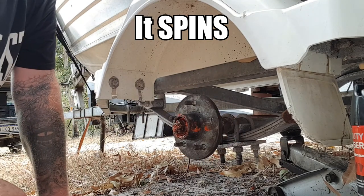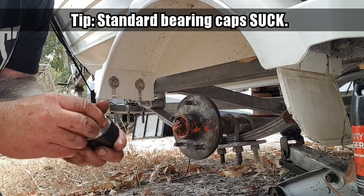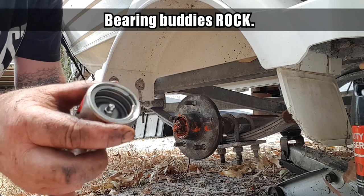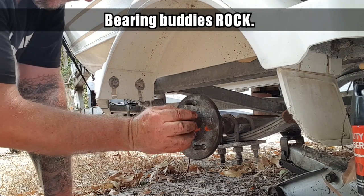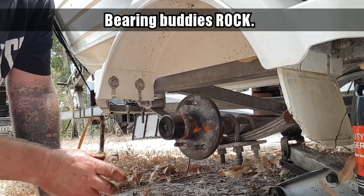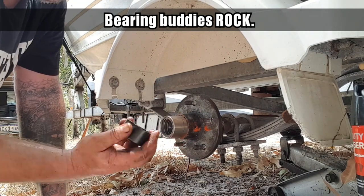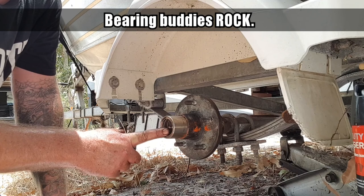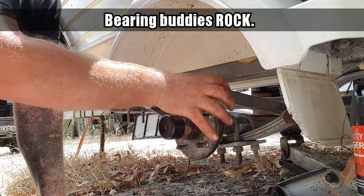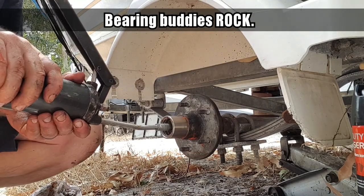Five wheel spins now, finish it off. Rather than putting my standard cap back on, I went and bought a Bearing Buddy - just got a grease gun for it. That goes on like so. Got a cap here - put a bit of grease on there, it will act as a bit of suction so it won't come off. So now I just put my grease gun on here and pump her up full of grease. It's as easy as sticking it on the grease nipple.